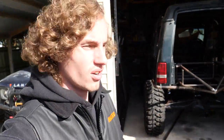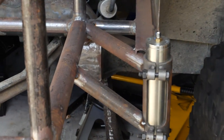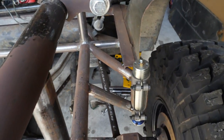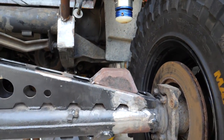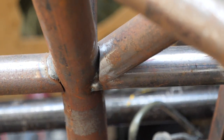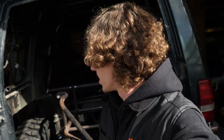All the mud traps are on. Truck looks awesome. Anyway, we're going to try and make some progress today. The goal for the end of the day is to get this thing rolled out of the shed. We've got a bit of work to be done before then. We're going to be having it sit on the bump stops, so we need to get these bump stops welded in properly. However, we possibly need to remake that tube. I think there's quite a decent size gap in that notch, which I'm not really happy with, so might have to remake that.